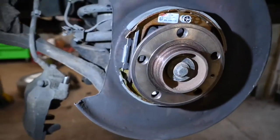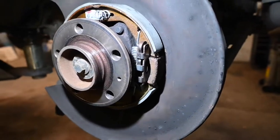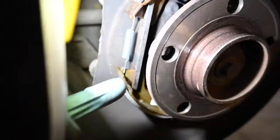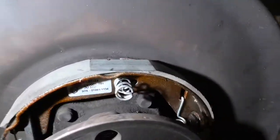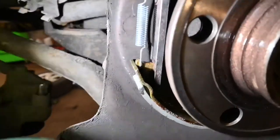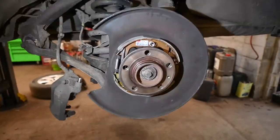So these are the new shoes and the new fitting kit in place. As I recommended earlier, start with the lever first followed by the upper and the lower handbrake shoes with the large spring attached. Then go ahead and put your bar in — which I have also cleaned up and put some copper slip on all the contact points. Then put the retaining springs in; they popped in quite easily because as long as you know how they go in, you can do it without necessarily looking. And lastly, do not forget to put that little spring in — it does play an important role and it is there for a reason. Because it's small and everything's held together, it is very easy to forget. So from here onwards we're now going to get the disc back on, the pads, carrier, and caliper.